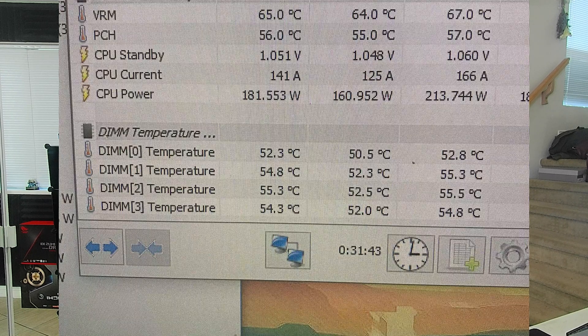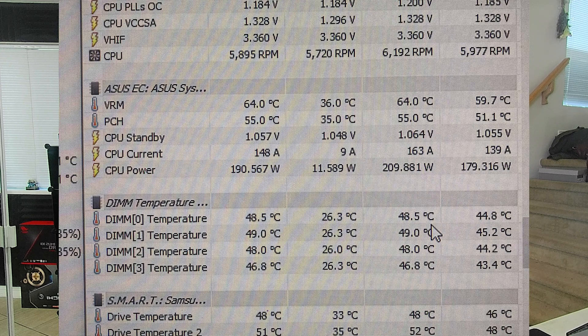Alright, I've got the results — I'm going to post the pictures and go over them quickly. The first picture is RAM stability at one hour OCCT with no extra fans, just case fans. The hottest RAM chip — Dim2 — hit 55.3 degrees, so roughly 55.5 degrees max. The next picture is with that tiny VRM fan slipped over the top of the RAM chips — the hottest chip dropped to 49 degrees, a six-and-a-half degree drop. Six degrees was apparently enough to go from unstable to stable.